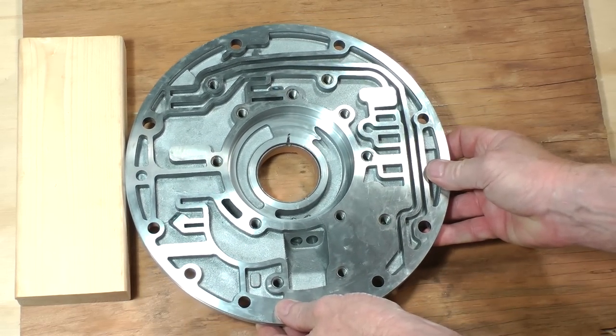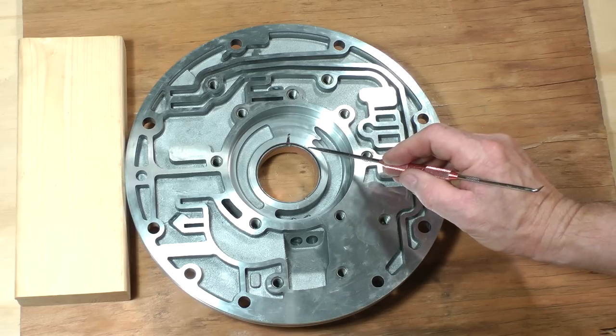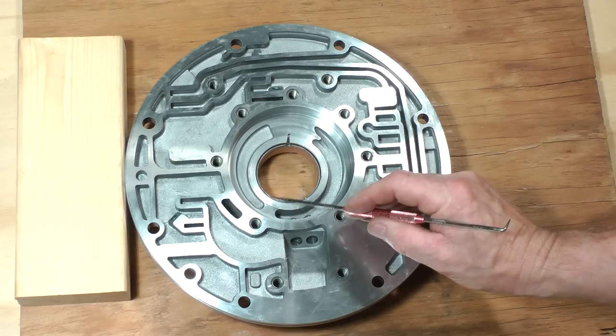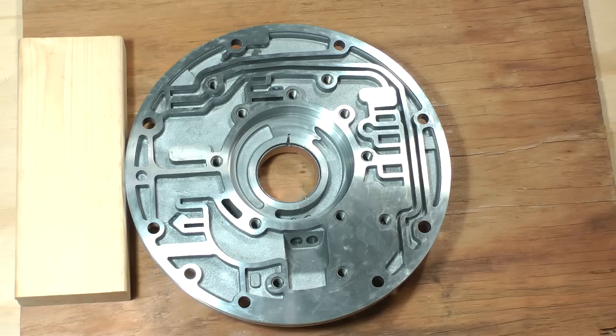Step 9 also describes how to make additional notches in the pump cavity in order to stake the bushing from this side too. If you do not have the equipment to grind the notches in order to do this, skip this procedure. The lip on the other end of the bore does a good job of preventing the bushing from walking into the seal.